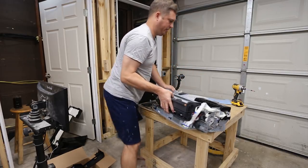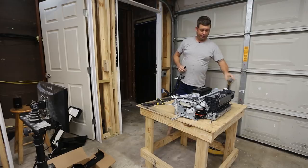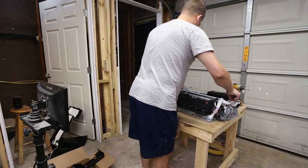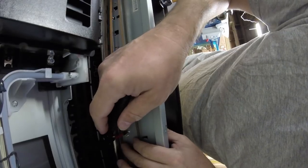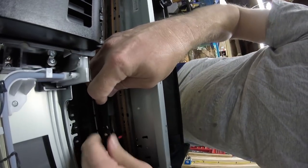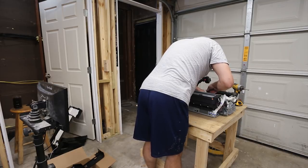In the front, we're going to need a stubby screwdriver. I don't happen to have a stubby screwdriver, but I do have a right-angle screwdriver for working on embroidery machines, and I can turn this into a stubby screwdriver. You want to be really careful not to damage anything in here while you're working, because there are lots of sensitive things in here. The belt is sensitive. There's an encoder strip that's sensitive. Just watch what you're doing.